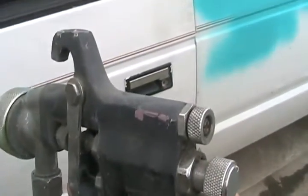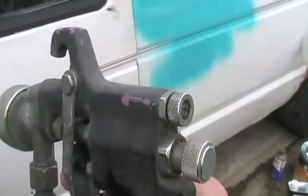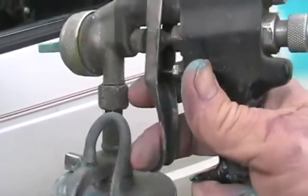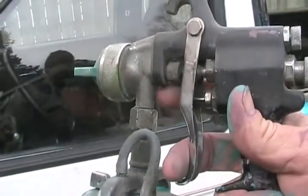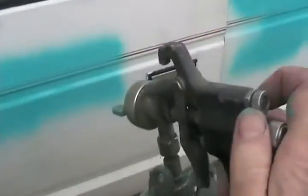And you can adjust these two knobs. The top one is the shape of the spray — whether it's a round spray, which is good for painting tubular things, or you want a wide fan spray, you can turn it and make it eight inches wide. The second knob is for adjusting how far the trigger pulls back to how much paint comes out. When you pull the trigger halfway, just air; pull a little more and you get some paint too. I have it set for fan spray now, as I was painting a sheet metal surface. It's actually a narrow fan spray — I could make it much wider. If I wanted to make a beam spray, I'd turn this in like that, and it comes out much narrower — so I could have it come out one or two inches wide, or like eight to ten inches wide if I wanted to.